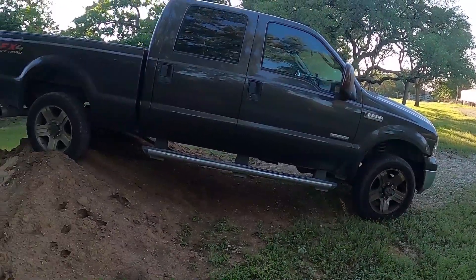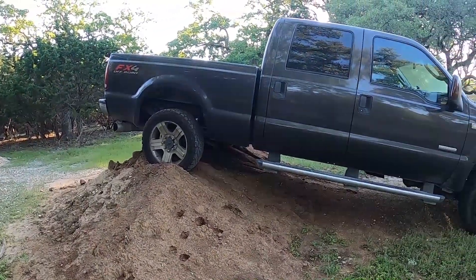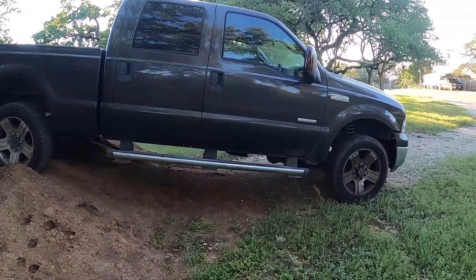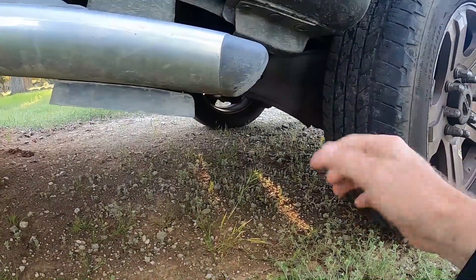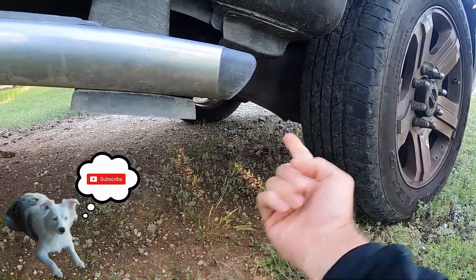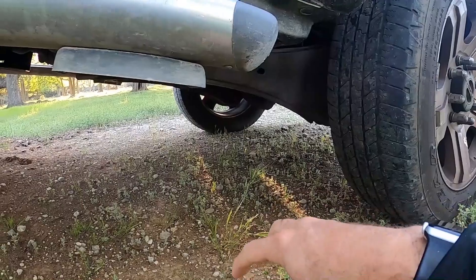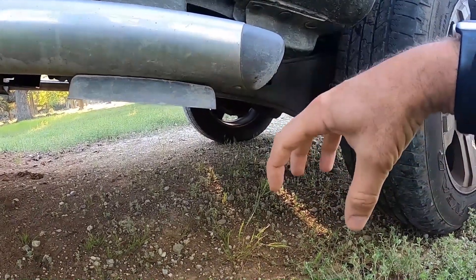A quick and easy way is to just park your truck on a hill, or like I did, find something to back up on so that all of the oil gets pushed to the front of the block. The front of the block is where the oil pickup tube bolts and then comes down to basically where the oil drain plug is — that's where it stops, right over that. You want to do that and let it sit overnight so that your results aren't messed up by driving your truck around the day before.